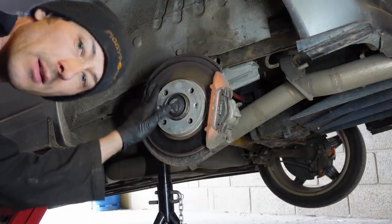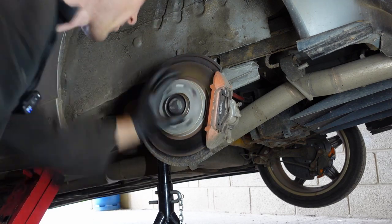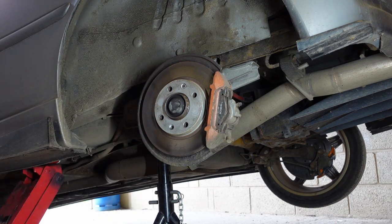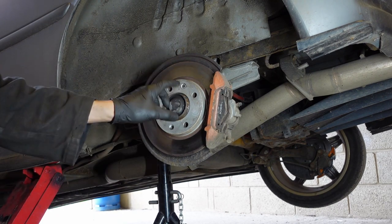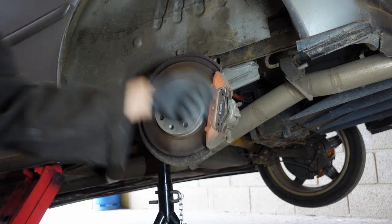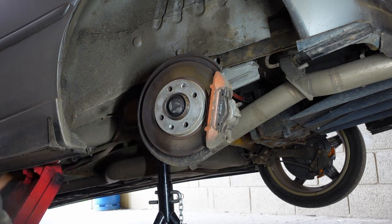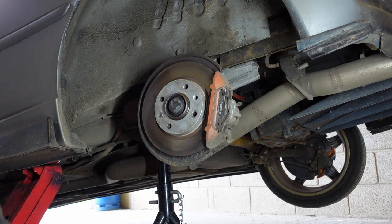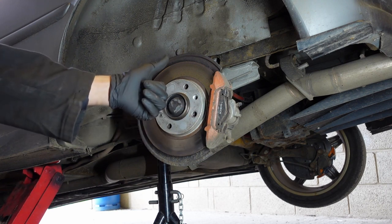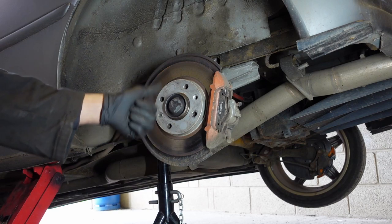See these brakes? They're not too bad — a little bit over-adjusted, a bit sticky, but not too bad. They're 247mm across, non-vented, with a decent enough caliper on the back that does handbrake and footbrake. Known for not having the greatest handbrake, but if you adjust it right with good cables they're fine. But I am going to change these for a 266mm vented setup.